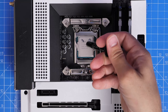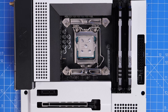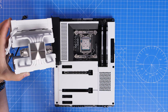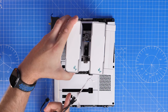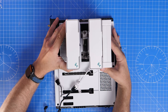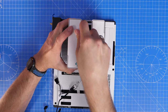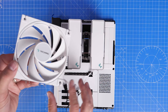Now for the thermal paste — people will no doubt tell me I've done this wrong, but the manual says four points on each corner and then a blob in the middle, and temps ran pretty decent doing it this way. Then remove the sticker on the cooler base, and seat the tower facing towards the front of the case — fans facing what will be the front of the case. Put it down where the two screws meet the top of the bracket, with two pins from the brackets pressing into it gently, then use the tool to tighten and screw it down.